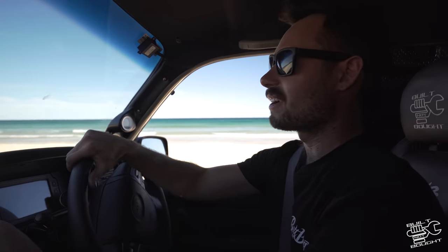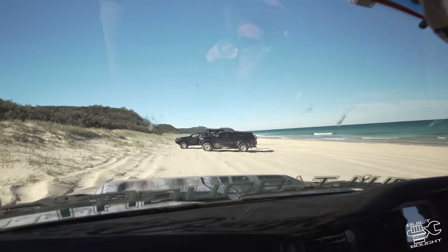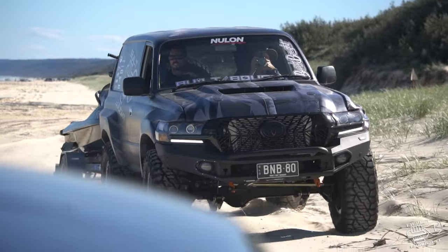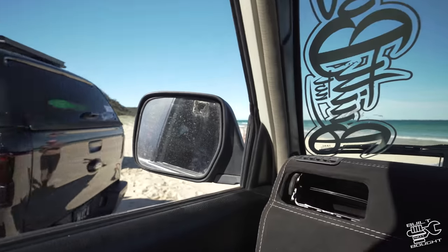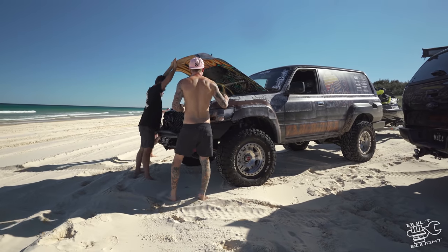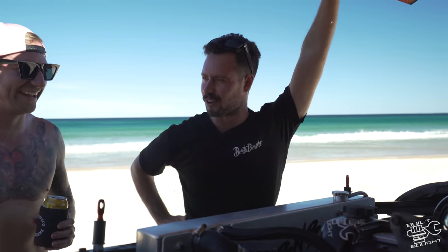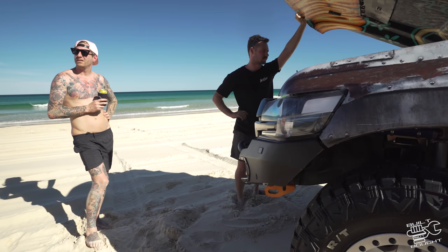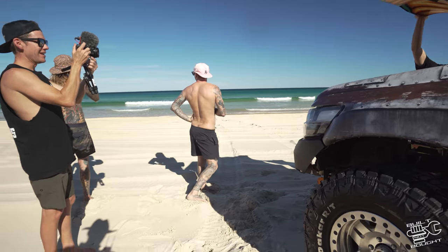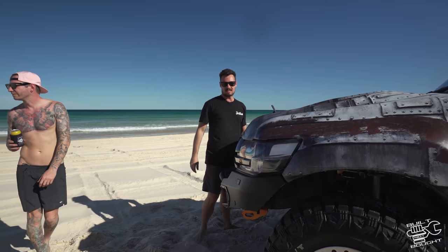We found them! I thought I'd be driving around for ages trying to find these blokes. It's not on fire for once! Let it cool down — it's gonna piss coolant, do a little wee, but yeah I need a bloody oil cooler because oil temps at 130 starts breaking down at about 120. It felt sweet though. Not on fire! There's not a breath of wind on this side, it's great. Anyway, it's time for a beer.